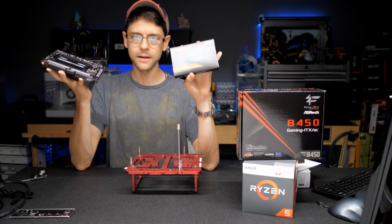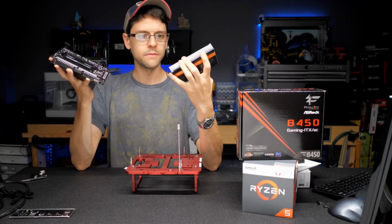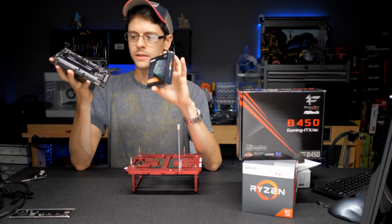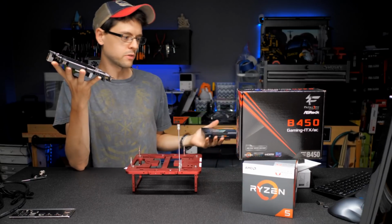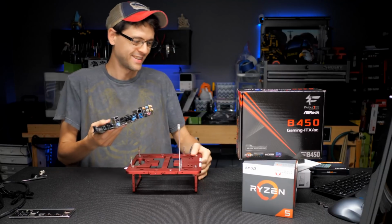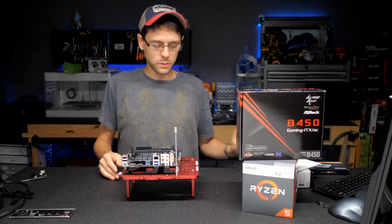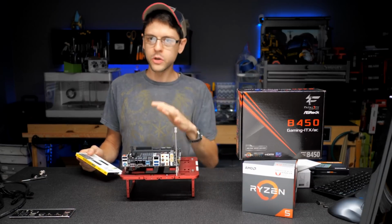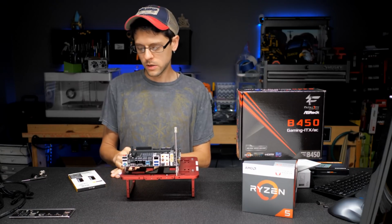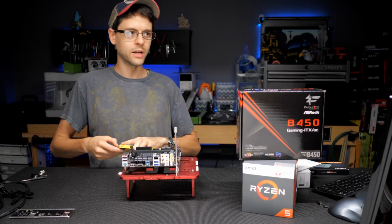a SATA SSD because they do not need anything near this fancy. I just want something as small as possible because they're really trying to keep to a budget so they can bill insurance for thousands of dollars for their product. So keep it as inexpensive as possible. But a lot of the newer boards are actually dropping SATA support from their M.2. So that's why I picked this board. It had dual purpose SATA/NVMe.